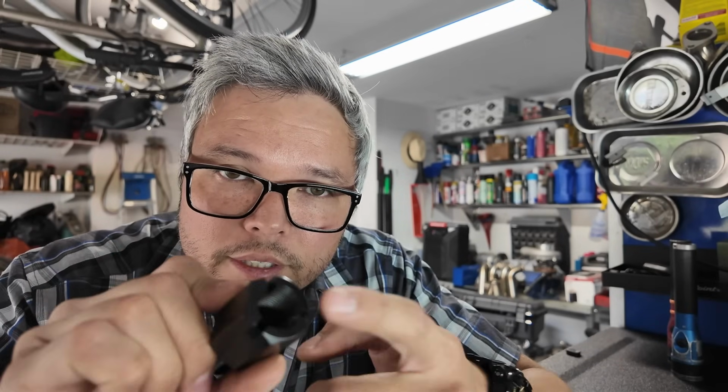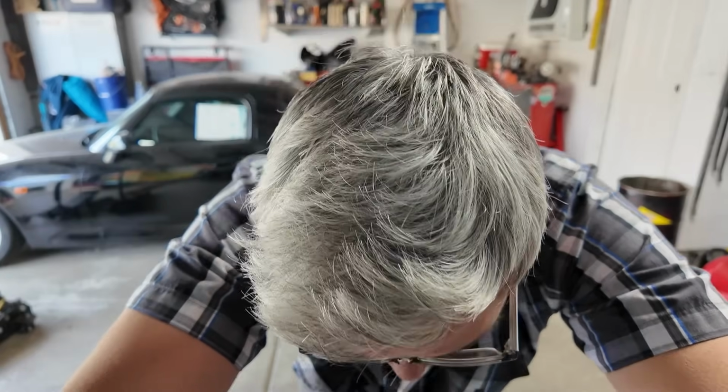And so with this being able to supply a little bit of a jolt to jar that oxygen sensor loose, it comes in clutch because everybody's been there. Everybody's been where they have just a completely stuck oxygen sensor, and this can definitely lend a hand. It also comes with this rethreader. You can rethread the bung or the oxygen sensor itself. So pretty cool kit, and I'm really glad that Tomas was able to show us that, and I was able to pick it up because, man, if I had this 10 years ago, holy cow, that would have saved a lot of headache.